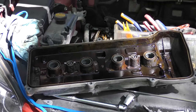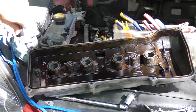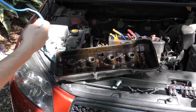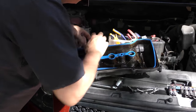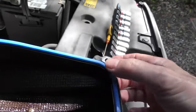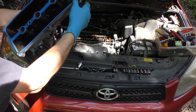Now we have the gasket. We'll put little bits of the weather strip sealer at certain spots — a little here, a little in the middle, a little there, then a couple dabs in the middle on the other side. Put the cap on tight so it doesn't dry out. Then you get the whole gasket assembly, check which way it goes, and start putting it on. Feed the whole thing around and press it in so it snaps — you want it in tight. Make sure it's all in its grooves the whole way around. The previous person didn't do it — this fell off when I picked it up because it was just in loose. When he put it on it twisted. This way with the 3M weather stripping, it can't twist. Let it dry about an hour. Now it's dry — you can see you can hang it upside down and it's not going to fall off.